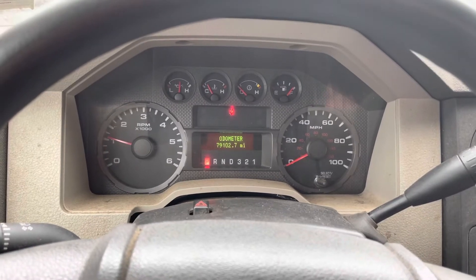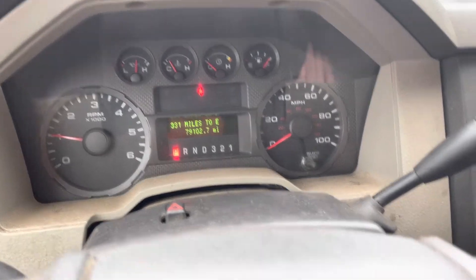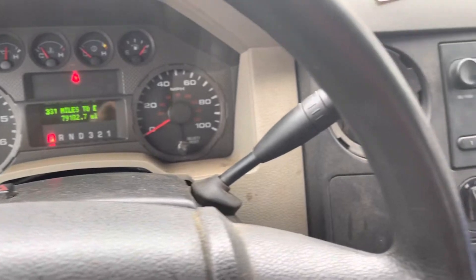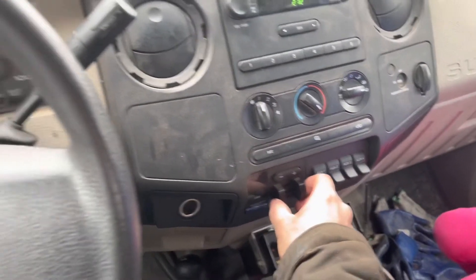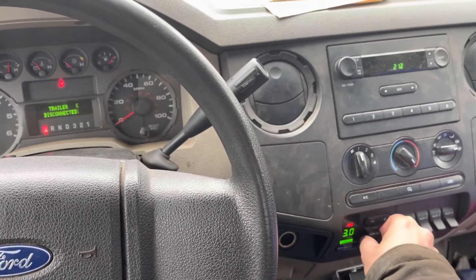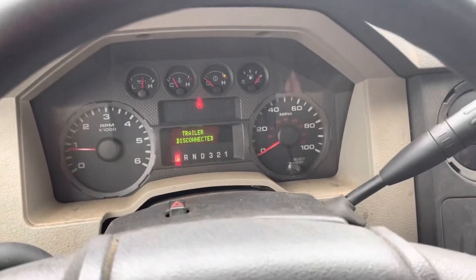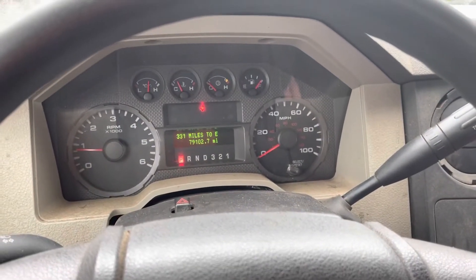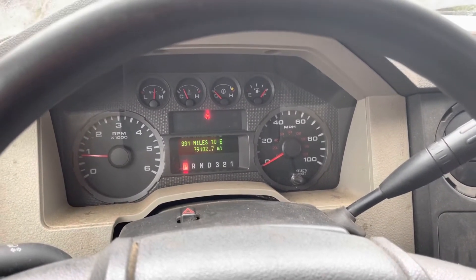All right, let's see — this is the worst part of intermittent faults, it might not come on. We have to decide what to touch first because once you touch it... let's try the brake controller. Yeah, 'trailer just connected' — okay, it recognizes that. That should go away. Now we'll try the brake — does not like the brake right away.